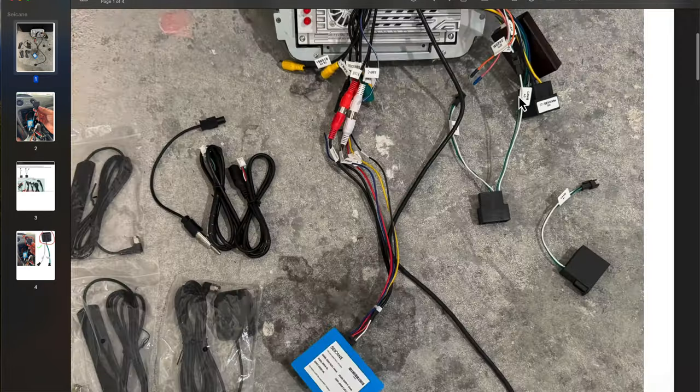We've officially disassembled all the rear trim needed to access the fiber optic lines. I've already disconnected them — that's why the radio is working — but I'll still show you where these clips are and how to install one of the fiber optic bypass connectors. Right here is the module for the cell phone, and on the side you'll find one of the fiber optic cables. Unplug it, pry off the casing, and you'll have two connectors. Put one end of the bypass in here, clip it, then put the other end in and clip it — that's how you bypass that connector.